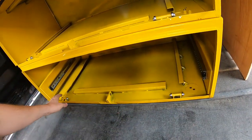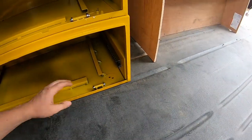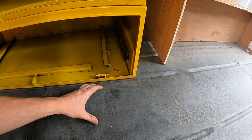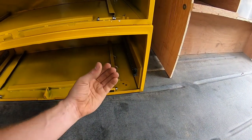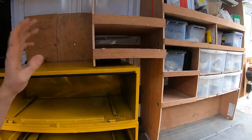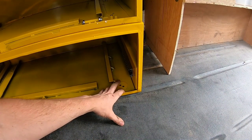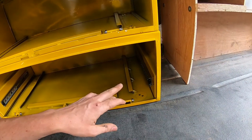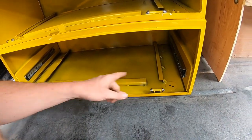The issue I have is the two front holes - there's a rectangular frame the whole van is built upon and those two are directly on top of it. I can't push it back further because it's at the back of the van, and pulling it forward puts it over the exhaust and exhaust shield. The struts are hollow upwards - I checked with a camera, nothing in there. Ideally I'd put the big bolts in, but it's not going to happen. So I'm going to use some big self-tappers for those with a blob of silicone, and drill the rear ones properly with bolts through.